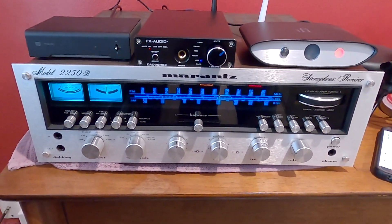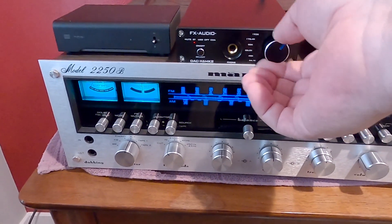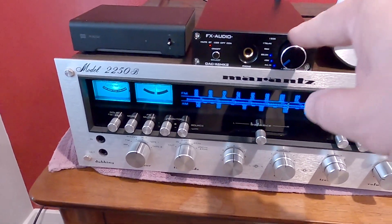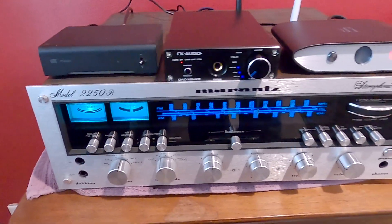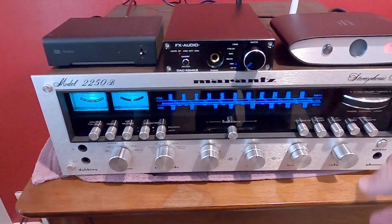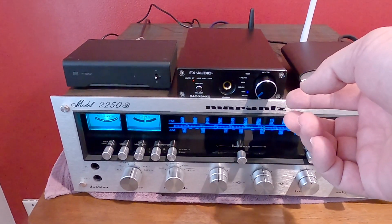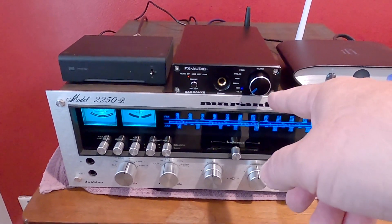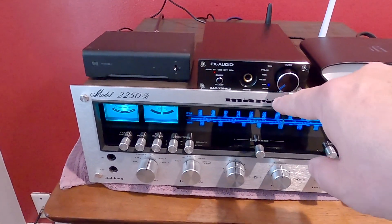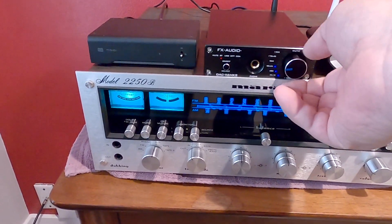Overall, I think it's a good piece of gear. I just think it has that quirk with the range and the rotary encoder. I would have honestly liked to have seen just a standard volume control on here. Also, because this is a vintage receiver, I have this so it switches on and off with the power plug. Every time you shut it down, it resets that volume control. I would have just liked to have seen an old-school regular 5K pot where no volume is here and up all the way is here, and then you can just leave it alone.